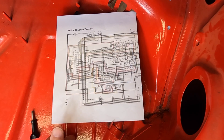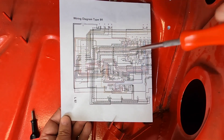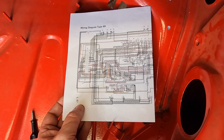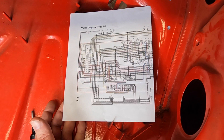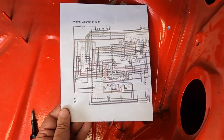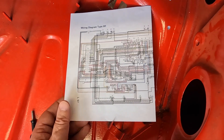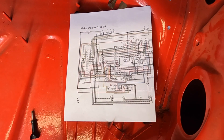The first thing I want to talk about, before actually wiring up the panel, is the wiring diagram. What we're looking at here is a copy of the original L57 diagram. The L57 is intended for the 911 and the L53 was intended for the 912 — almost identical diagrams with minor differences. If you're trying to wire up your fuse panel using this diagram, it can be confusing. They put the battery up here in the diagram at the top, but the battery in this car is down front, up by the front bumper.